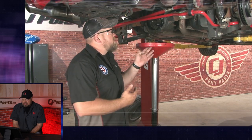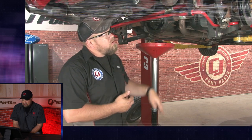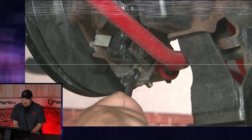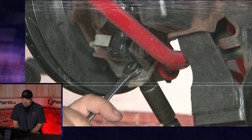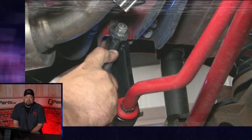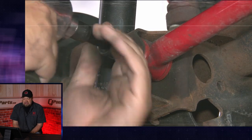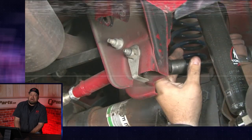Now that we have the wheels off — this was a video people had been asking for, and it was something we definitely knew we were going to do at some point. Remove the sway bar, then remove the caliper brackets for our brake calipers so we can remove the rotors and then be able to remove the axles. It is messy, it is time consuming, and it is definitely one of those installs that for most cases is better left to a professional. But if you wanted to do it, and you have the right tools, and you follow what we did here, you can swap the gears out.